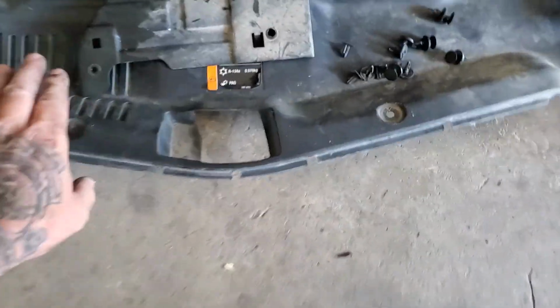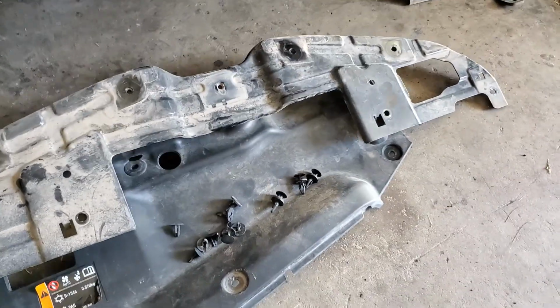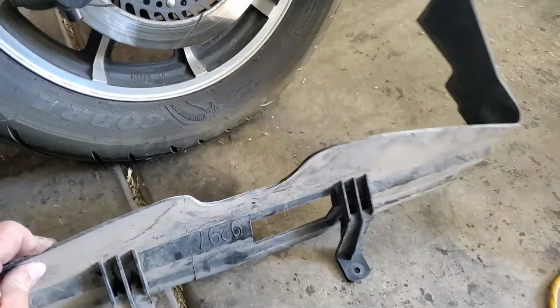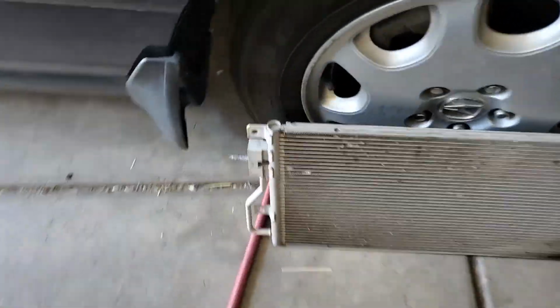So I loosened the headlight, I undid the line, and I took off the top cover, the next plate under it, and then this little shroud that wraps around it. I took off 3 things. 4 bolts out of the condenser. Condenser pulls right out the top.